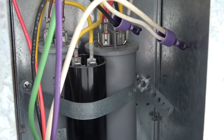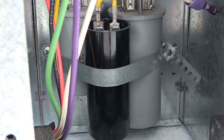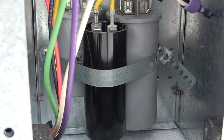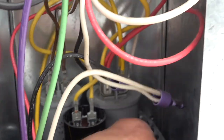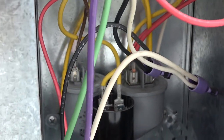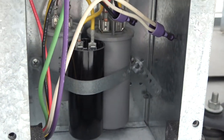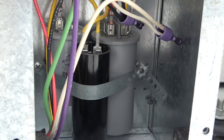Okay we have those back in there now. I changed the order a little bit because of the different size of capacitor, so I put the smaller one in the front just to make sure it's all held tight. You just want these all to be nice and firm in there and not rubbing the bottom — that way when they vibrate and shake while you're going down the road you don't have any problems with rubbing or clunking or anything. You want it all to be tight, no wires pinched — so just make sure of that.